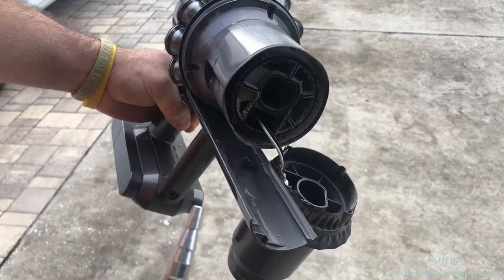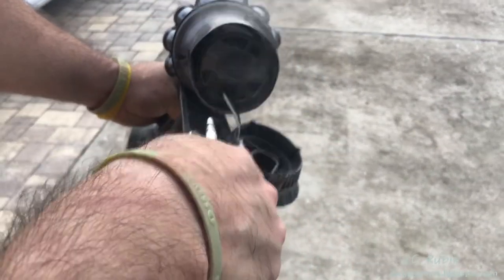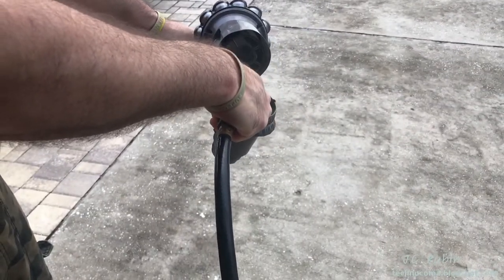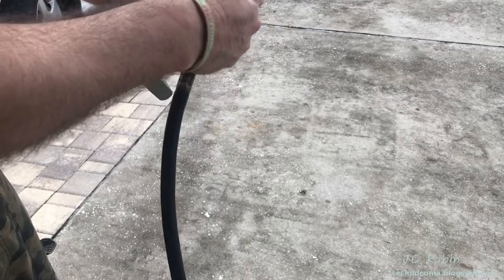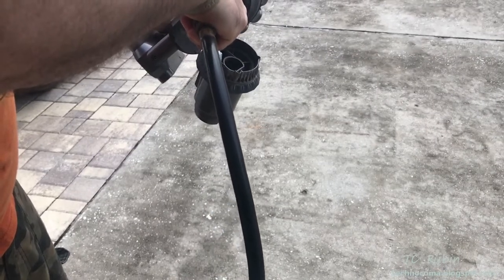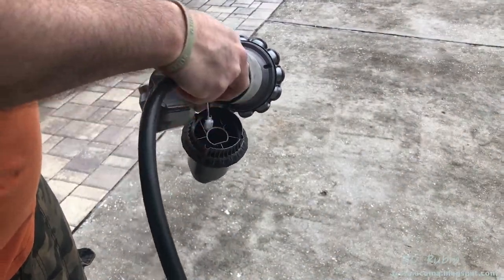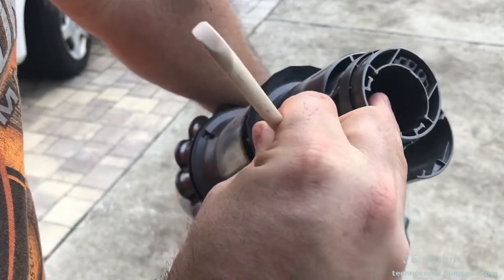This part is extremely unpleasant and mildly disgusting, so make sure you wear a mask. Also make sure the canned air doesn't blow out that gasket - mine came loose when I blew it with air. I was actually somewhat surprised at the amount of dirt that came out of this vacuum cleaner. The level of dirt retained in this thing is quite unbelievable. I use a paintbrush to remove more stubborn dirt from the corners, then again with the air to remove dirt loosened by the brush.